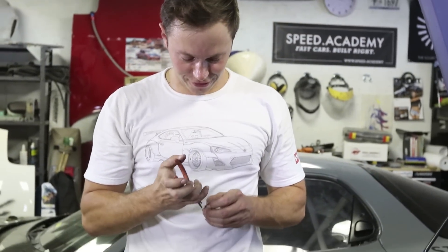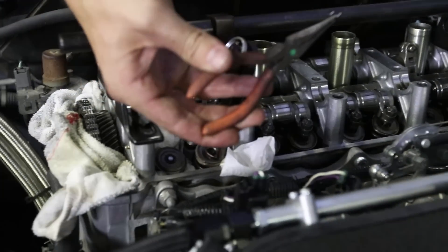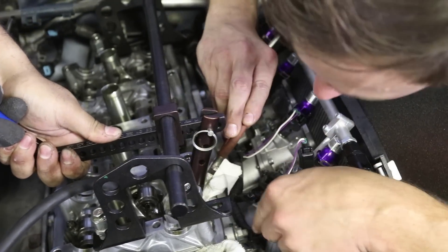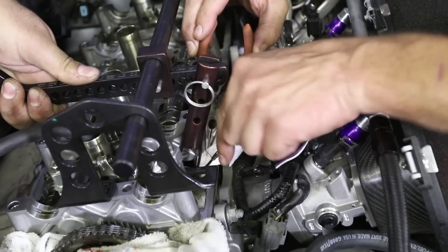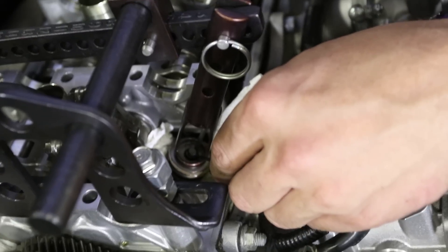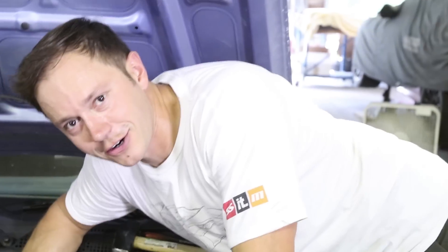The tool is magnetized — that's making it difficult to place the keepers. After some struggle and multiple attempts, one keeper finally seats. One down, seven more to go and it's going to involve a lot of cursing. After doing four of these I figured out the best way: you really need to hit it hard to free the keeper, then once one pops out you push the seat down and the second one comes out. Retainer's off.